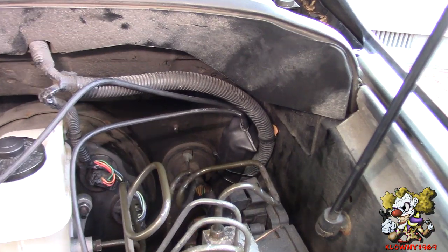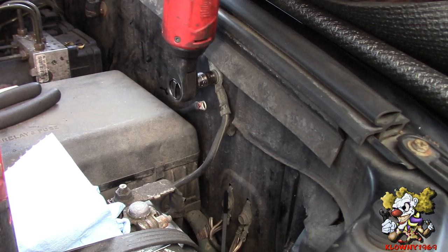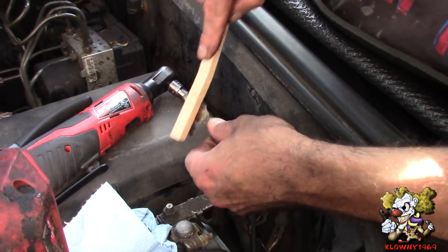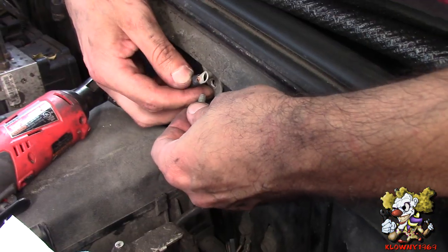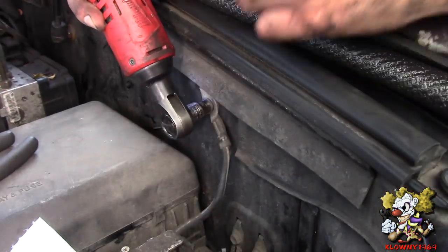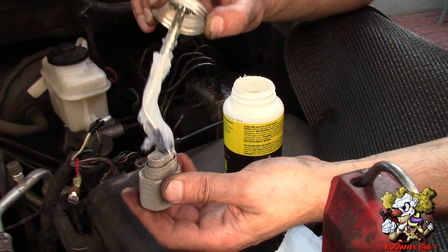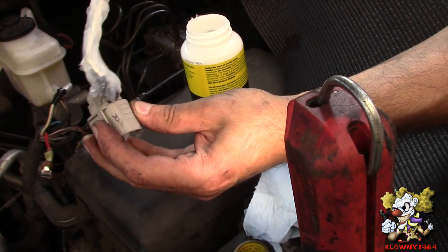And that's mounted. Now from the proxy pack there's a ground — route it over here to the negative ground from the battery. That's a 10mm bolt. Get a little wire brush and clean this out — comes out nice and shiny. Tighten it back down and you're good. Now I have some dielectric grease and I'm going to put some back here because we had an issue with this one — it corroded and leaked past the seals. So put it all around here and make sure this whole thing is sealed.